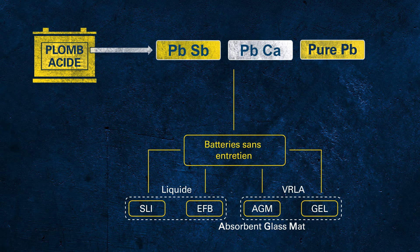AGM stands for absorbent glass mat, which indicates the main technological difference to a flooded battery. In this kind of battery, the electrolyte is no longer free, but fixed — absorbed in a glass mat separator. Each cell of an AGM battery is sealed from the environment to ensure proper function. Every cell is equipped with a separate valve to release potential unwanted overpressure, to avoid permanent damage to the battery. This construction and function principle provides higher performance and reliability than a flooded battery ever could.